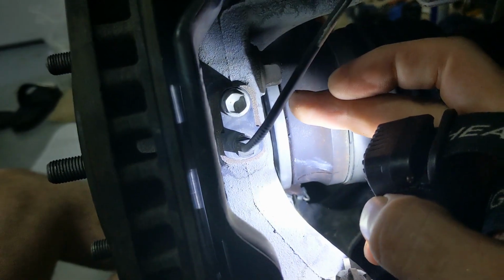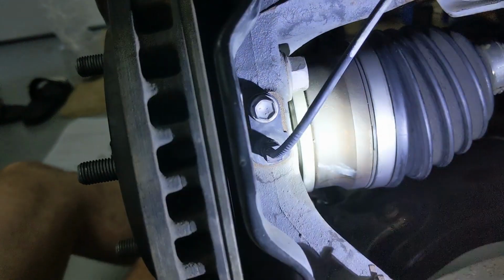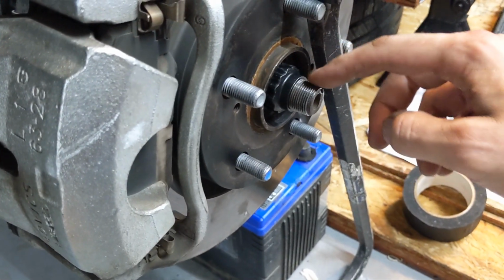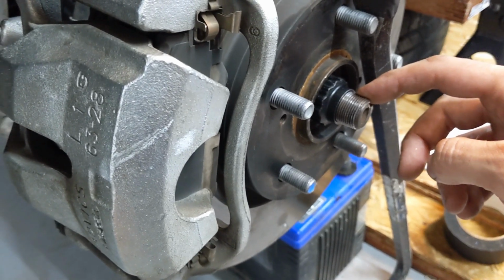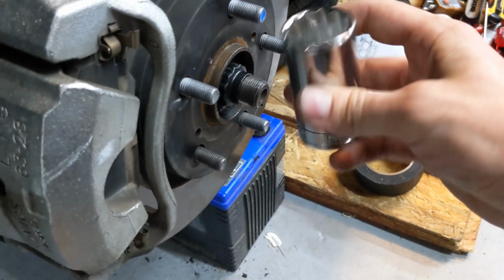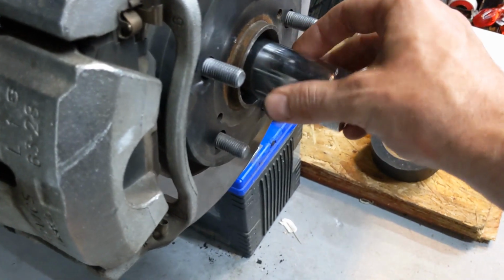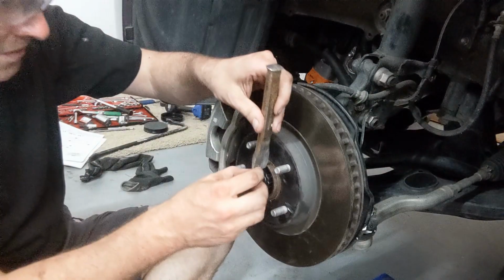And there is a metric 10 or socket 10 millimeter and 8.5 Newton meter torque on both sides of the car. Next, clean the internal and external thread with solvent that completely evaporates, then torque it with 215 foot-pounds. For this we use the 30 millimeter 12-point socket. Next we have to stake the nut.